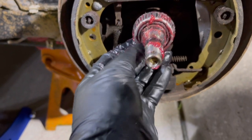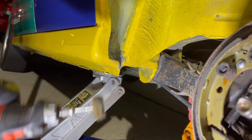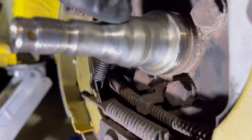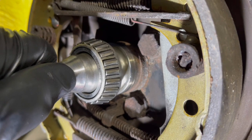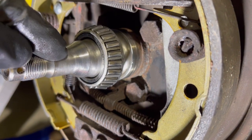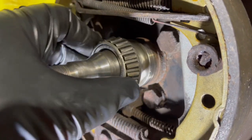That's why we had a problem getting the drum off before. I have a Dremel tool here with a little polishing attachment, and I've been going around this cleaning up all the rust and test fitting the bearings. Right about back here is where it's still dragging. This is the old bearing because it's completely free of grease, so I'm testing with that. Once it's nice and smooth I'll switch to the new bearings. This is an issue that happens quite often, so be prepared for it.